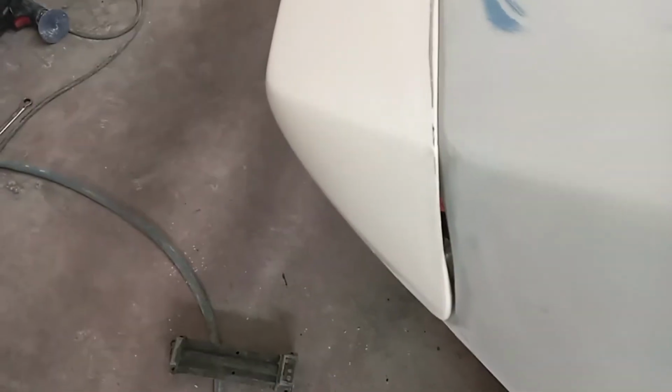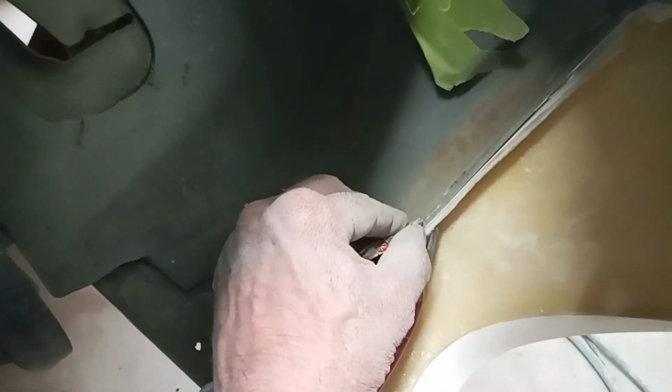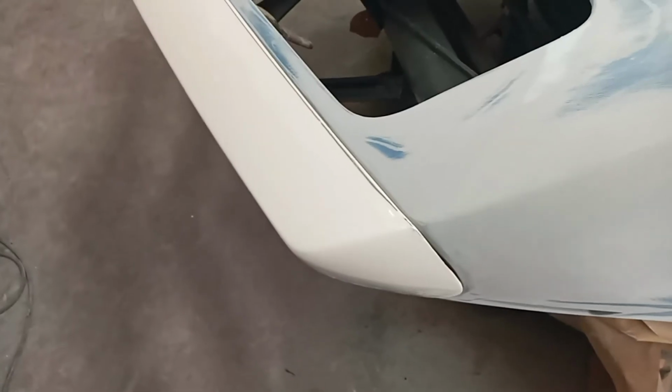So, all that leaves me with, it's hard to see, but I've got some gaps, a lot better than where I started. Gotta get in the right angle. And I don't know how well this is gonna show up, but if you can see that fiberglass in there, you can't very well. At the top, there's a slight gap, and then as it comes down, it's opening up. So what I'm gonna do is carve that lip back. If I gotta build it up later, I will. But to tighten that gap up, and then these top corners, the only way I'm gonna fix those is to build this back side up, which I'll do with fiberglass. So it wasn't quite as terrible as I thought it was gonna be, but I'm not done yet either. So I'll keep going, trimming, cutting, hacking, and I'll bring you back later on.